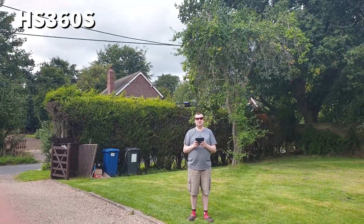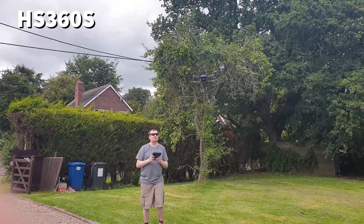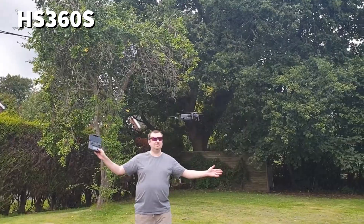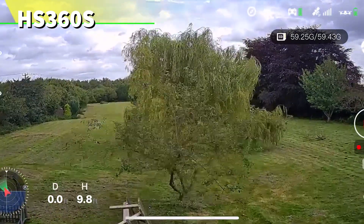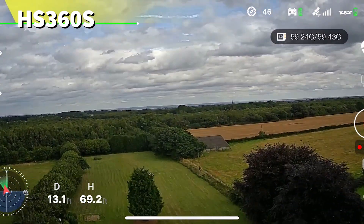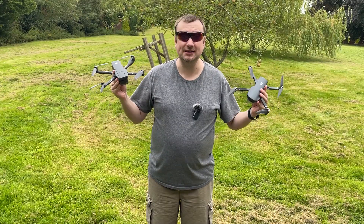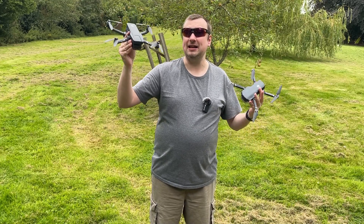The other big advantage for me with the 360S is I just find it so much more comfortable to fly. The GPS technology seems to have improved drastically over the 720G. Both have GPS so they generally keep their position, but the 360S does a much better job. I feel far more comfortable flying this drone — I will push the boundaries with it, whereas with the 720G I tend to be more cautious. And even though the 720G has better optics, I tend to get the shots I want easier with the 360S. Also, if you want to push the range, the 360S is rated at over 9,000 feet whereas the 720G is a little over 3,000.